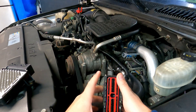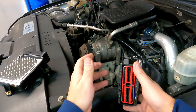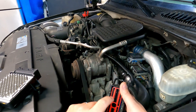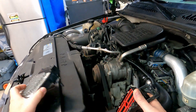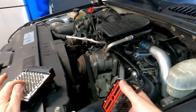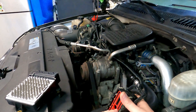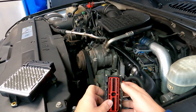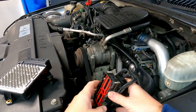On the six-speed trucks the connector is a lot better than on the five-speed. The five-speed trucks had a lot of issues with pins pulling out. When they went to the six-speed trucks it has a completely different looking module. The modules themselves are problematic on six-speeds, but the five-speed trucks more often than not have a connector issue — your module is fine, you just need to find the pin that got pushed back, push it back in, and secure it.